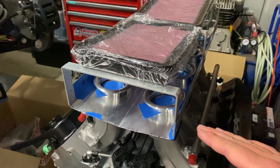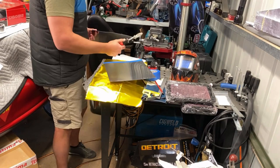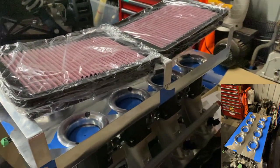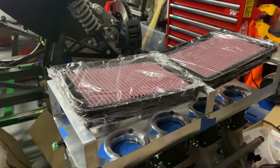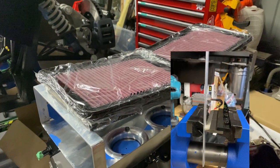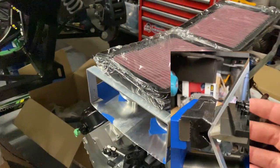You can see how the bottom of the filter box is starting to work together. What I'm trying to do is maximise the distance between the bottom of the filter and the top of the trumpets, so I can ensure we're getting a fairly even flow of air to each of the cylinders. Obviously this height is something we'll need to contend with in terms of how much clearance we have from the top of the motor to the bottom of the clamshell when it's closed. These filters are sized off K&N's website — I'll put a link in the description. This is heavily oversized versus pretty much everything else on the market. By reducing the airflow velocity across the filter, you reduce the pressure drop across it, and a freer flowing intake helps performance across different parts of the RPM range, with good consideration also for maintaining performance when part of the filter is clogged.